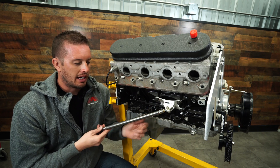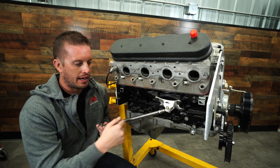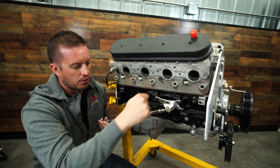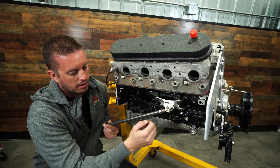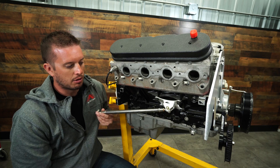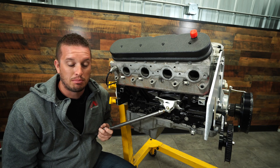After you get a conceptual idea, you can measure and cut to length, then weld your two rod ends — or just tighten the bolts through the window right here. If you don't feel like doing that, you can take a Sharpie and mark the position, pull it off, and tighten the bolts real tight. You have a little bit of wiggle room there, which makes things really easy. It's really that simple.